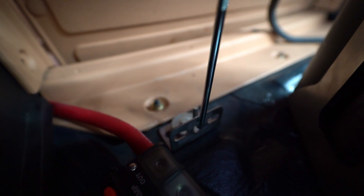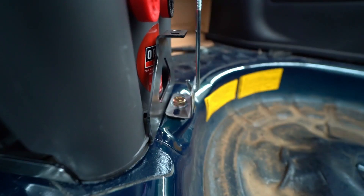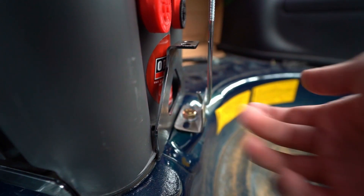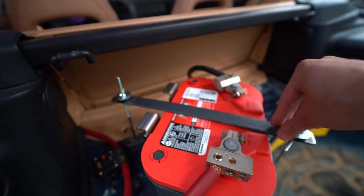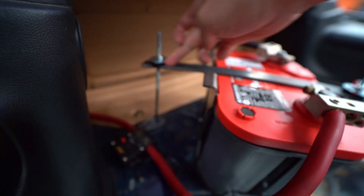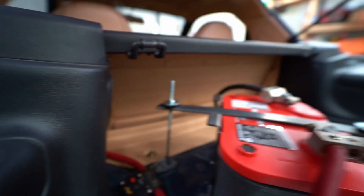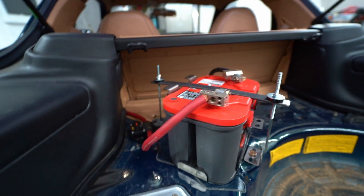It's kind of hard to see in there, but same thing — you get an L bracket, some washers, and a bolt. This bolt is, I believe, a 10 by 1.25. Then you get an L bracket here, put a J hook through it, and then just get any piece of bar. Just make sure it's a sturdy piece of metal, because there's nothing underneath this section so it'll kind of bend — you can see it bend just barely. Drill two holes into the bar, have the J hooks come through, clamp it down, and you are solid with your battery setup.